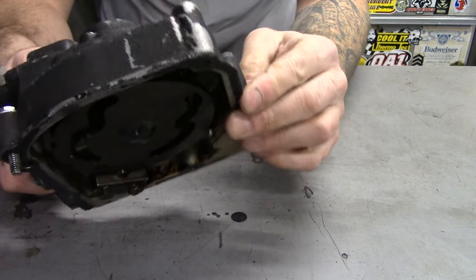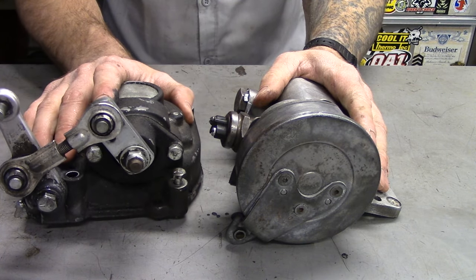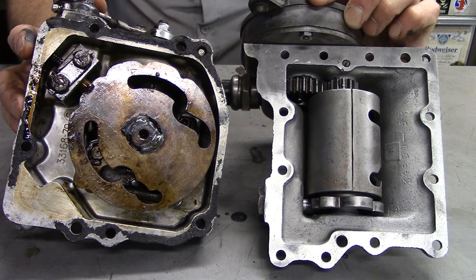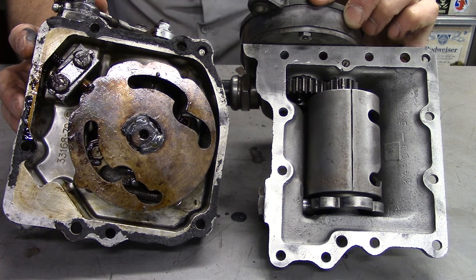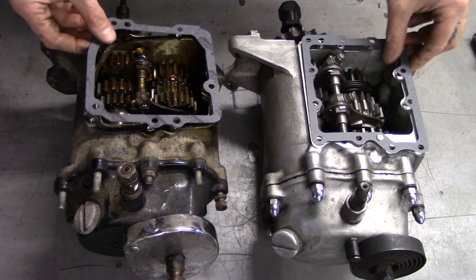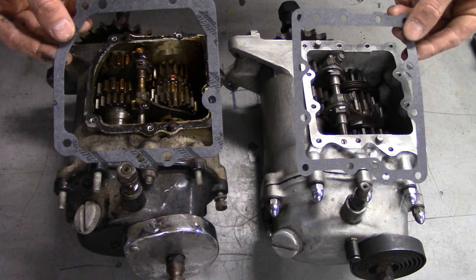Good design, works really well. A lot of guys are always asking, can I put a ratchet top on my rotary top transmission? And the answer is no. If you look at the bottoms of these, you can see that the shape of the casting is completely different. This is a ratchet top style four-speed; this is a rotary style, and you can see in the gaskets how different the bolt patterns are.